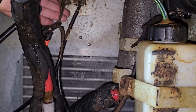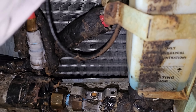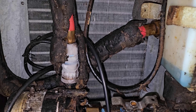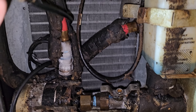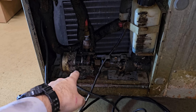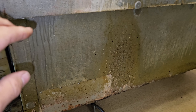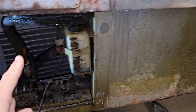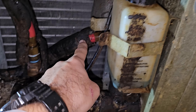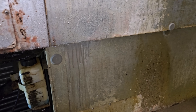The instructions say to disconnect all the power connections in the back. Here's the glycol pump. On these units, they use a glycol pump to circulate glycol — it's a secondary heat transfer fluid. Instead of running air across an evaporator coil with refrigerant in it, they have a flat plate heat exchanger in that insulated material. The refrigerant stays on one side, and the glycol runs through these tubes, pumped through the cold rail and the base section, so there's no refrigerant where the food is — it's just food-grade glycol.